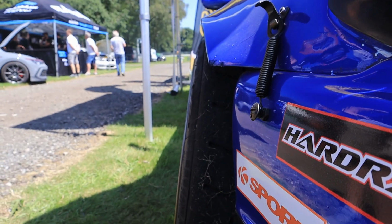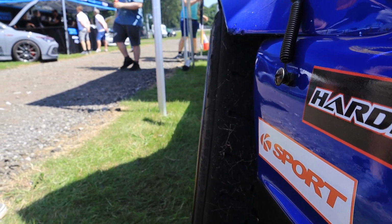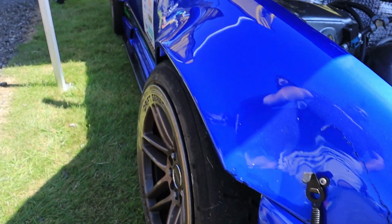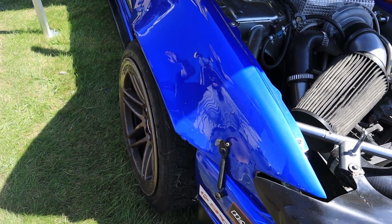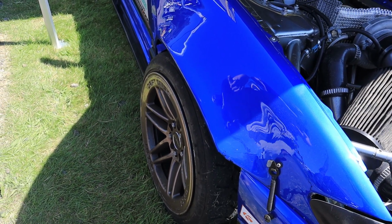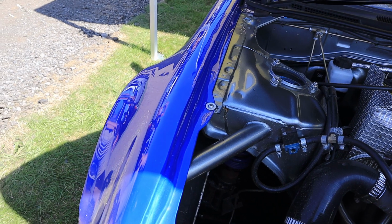And then you're tucking it in by running quite a lot of camber. I mean, by drift car standards, it doesn't feel like a lot of camber. No. But it's about 5 degrees of camber at the minute. Some people do go more, sort of 6.5, but I find 5 works nicely for me. Still get good contact pattern on the tread when you're on full lock. Sure. One of the things that people don't realise about why they do it, not just for looks, is when you go on full lock, your wheel basically drops over on itself. So you want to try and avoid that as much as possible.